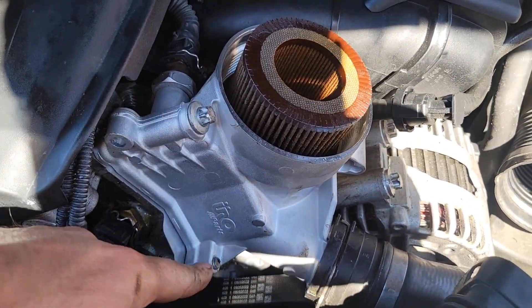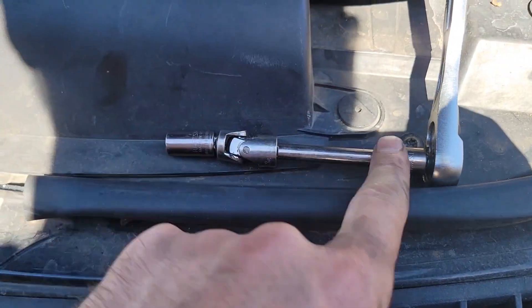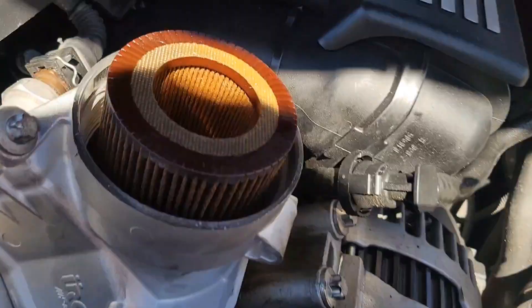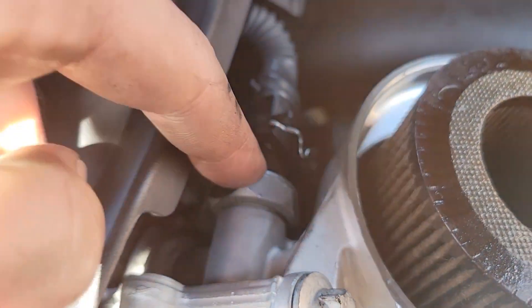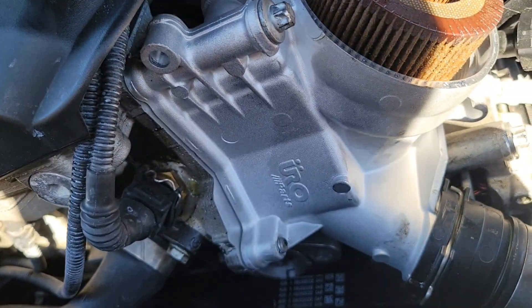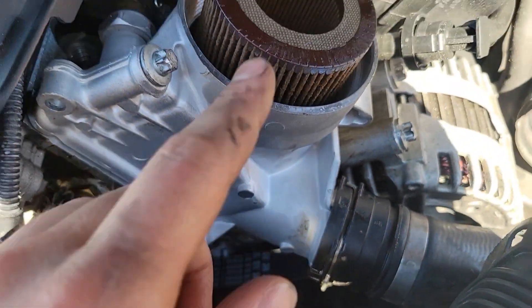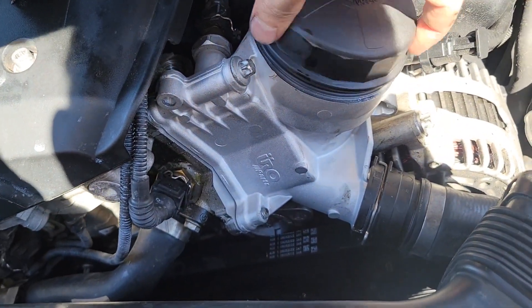Okay, wrapping up — just replacing the bolts. I was actually able to go from this direction down through here towards the third bolt. I had to use a quarter drive with just a little extension and a bit of an elbow — size 8 remember — and I was able to ratchet in a little more smoothly. I would do that for the rear one. When you're putting this one back in, just make sure the part with the tab is as close to up as possible because that's where your retaining clip is going to go back on. Don't forget to replace your retaining clip and make sure the hose is pushed all the way forward. Make sure you return your filter, then put your new cap on and you're good to go.